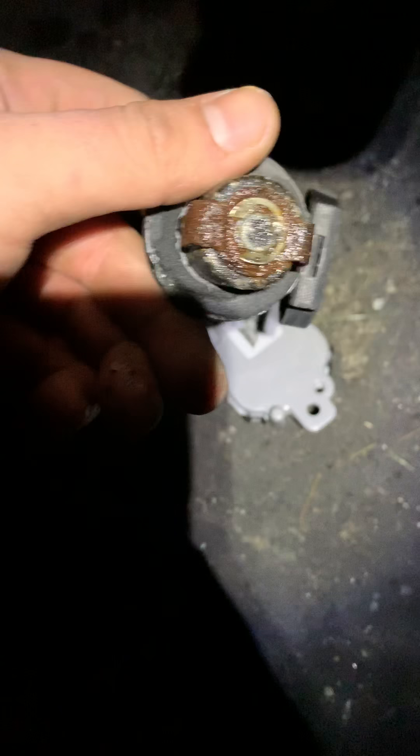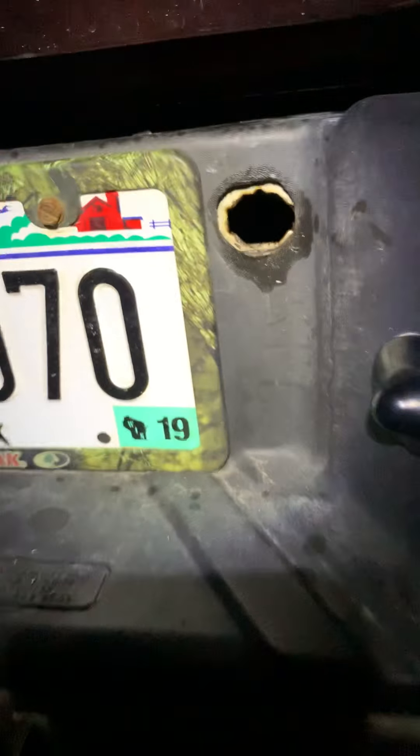The cover itself should show you exactly where they're all located. You do have to drop your spare tire, so grab your spare tire kit and make sure you get that loosened up. Mine's kind of corroded and rusty — pretty gnarly. You take your main key out, it just pops right out. There's a tube section — use the skinny part of your spare tire tool kit, lock it right in, crank it down lefty-loosey, and the spare tire drops down.